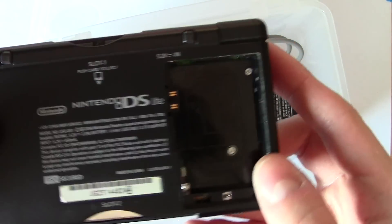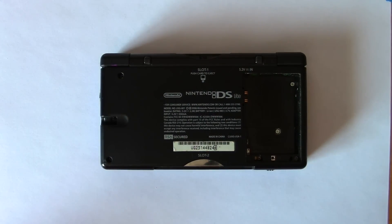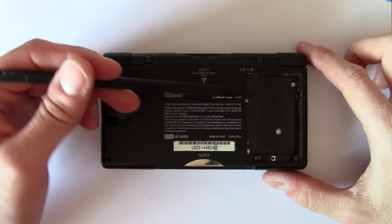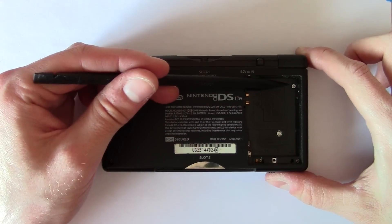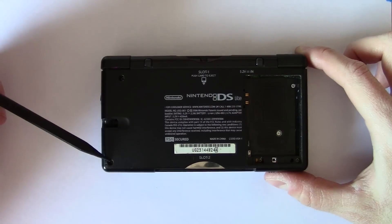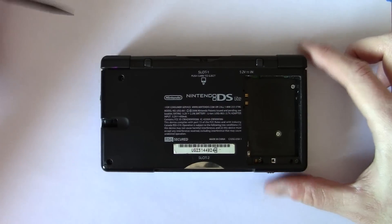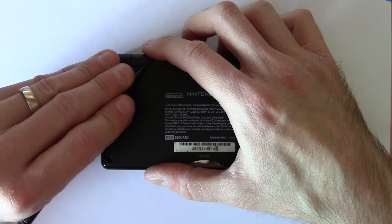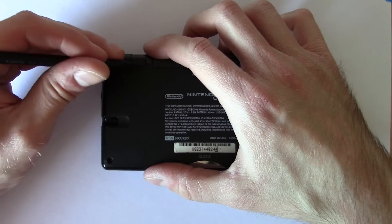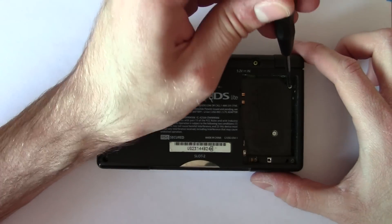So let's take a look at what we're actually working on. Here's the unit — I've already pulled the battery and battery cover off, just to make life a little bit easier. There are a few different types of screws around the outside that we need to remove in order to get the bottom cover off. Once you get the battery cover and battery out, you'll notice that there's a Phillips head screw over here, and then down in this well there's a tri-wing screw. Over here we have another tri-wing, and then there's a couple of screws underneath these rubber bumper covers. Let's go ahead and get those rubber bumper covers removed now — I'm just using the pointy end of a plastic spudger. These can also be had off of Digi-Key for just a couple of bucks.